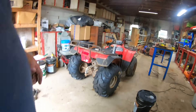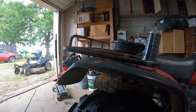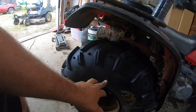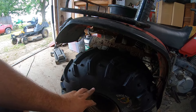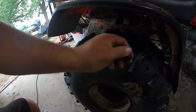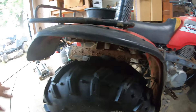Those tires look way better! I looked it up — this is a 25 by 12 by 9, and it looks like from factory it was 25 by 11 by 9, but there are basically no options for tires in a 25 by 11, so we went with the 25 by 12s. They're Destone Swamp tires, about 110 bucks a piece mounted — definitely budget-friendly. There's not a lot of clearance, but it looks like it'll be alright.